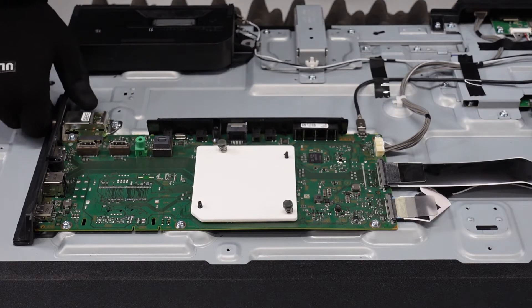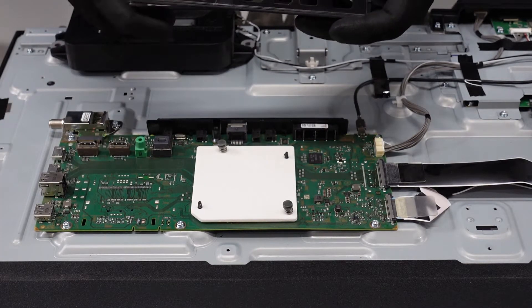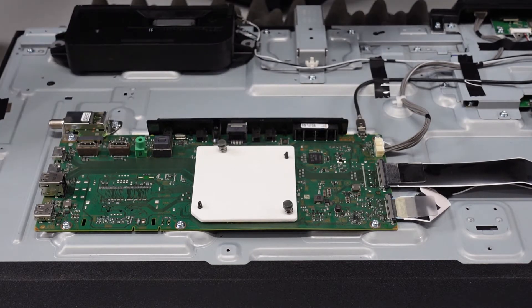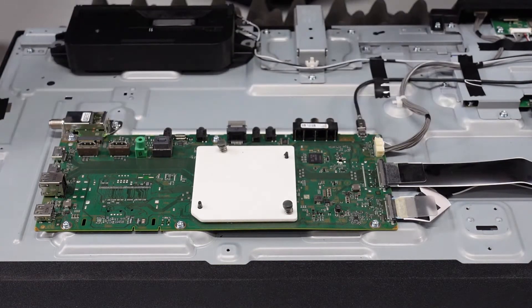At this point, we can work on this flashing — just pinch down on that coax cable and slide it forward. If you need to use this or this other piece here on the back side for a replacement, just hold on to them and you can put them onto the new one. This one here, exact same situation — just slide it completely forward and it comes free.